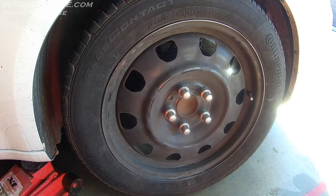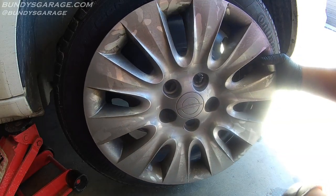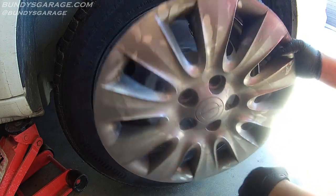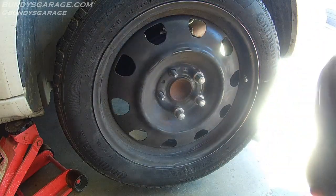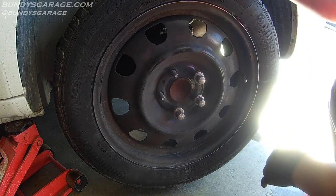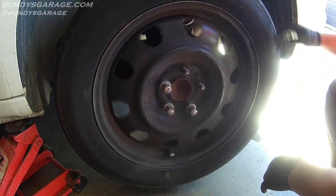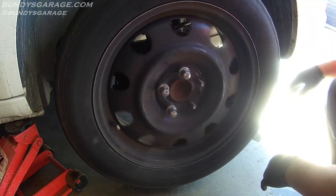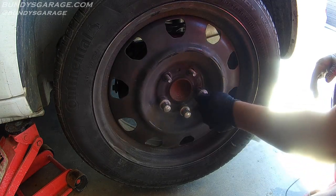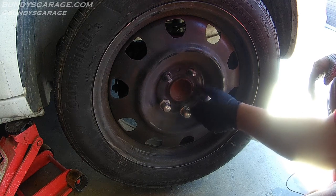Raise this up off the ground. Usually there's a cover on the rim but I had to pull this tire off a couple days ago, so I left the plastic cover off because I knew I'd be doing this job soon. This is what the customer could hear while driving — that's the sound of the little metal sensor touching the rotor.